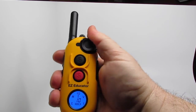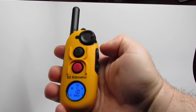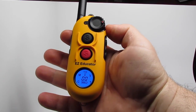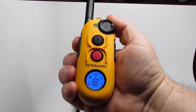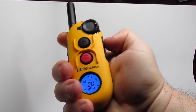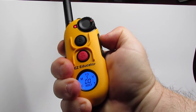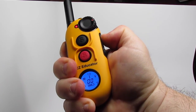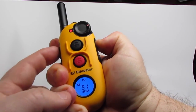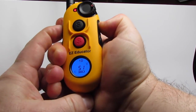Make sure you're at 0 or 3 o'clock position before you do any programming. Press and hold 1 second. It's flashing, so it's unlocked. So press and hold the program. Now you have to hold it down the whole time and then touch S1 button, let off the S1 button. So what we want to do is hit the S1 button again, see it circulating.